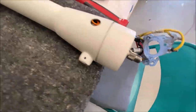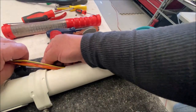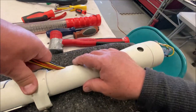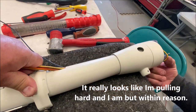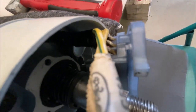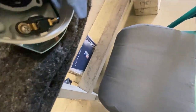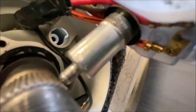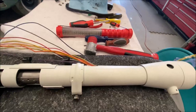Now we've got to finish putting the turn signal switch in. You want to pull on all of the wires except the prindle light wire, which is the black wire, and gently pull on these while positioning. The prindle light wire needs to sit into that groove. See it popped into that groove — it lays down in there — that's where it has to go. That way you won't crush it underneath the turn signal switch.